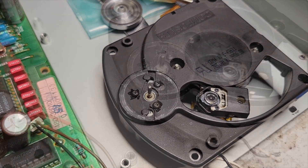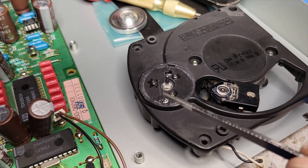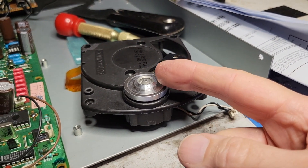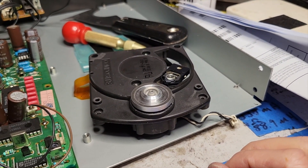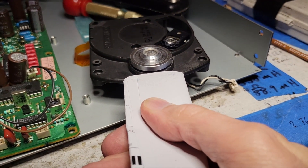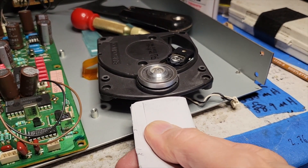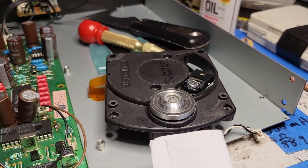I hope that'll keep these things from starting to loosen again. I got the motor back in and this little bushing back on there, along with the little piece of stiff wire that's spring-loaded in here to hold that bushing in place. As hard as this thing was to get off, it went back on much more easily — perhaps because of the oil I put on there. I shoved it in between and just pushed it straight down as far as I could against the paper, thumbs on either side, then used the calipers to measure how high it was up off of here. Got it to about within a tenth of a millimeter — should be good.